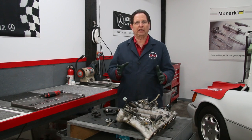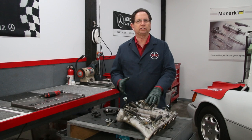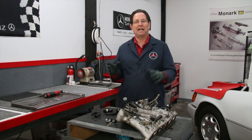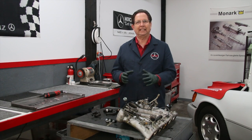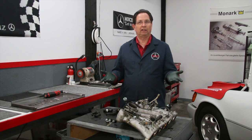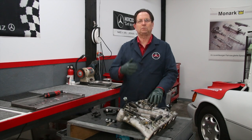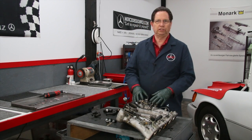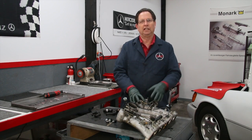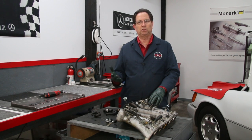There are a lot of issues because of age. When you talk about anything that's 20 years or older, it seems like 18 years is the magic time when plastic and rubber parts start to accelerate their wear and failure. As the CIS fuel injection systems evolved, they had more and more rubber hoses — used for things like cold start injection, breathing, and idle speed control.